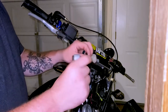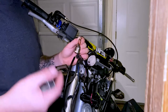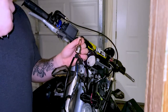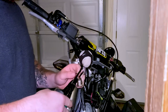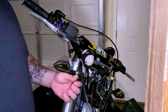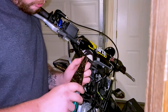Next we're going to cut these two wires. I already know which wire is the power and which one loops into the starter solenoid. It usually doesn't matter because most of these switches don't push power one way or the other until the switch is closed — that's when the button is pressed, the circuit closes, and power runs through both sides and activates. We're going to clip the wires near the base of the old switch. I'm going to figure out the gauge — I'm pretty sure they're 16 gauge.